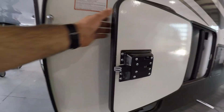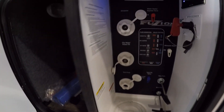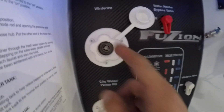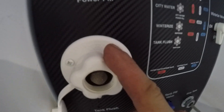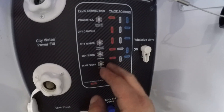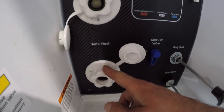Right on the driver's side here you're gonna have your hydraulic level. Right to the right of that you're gonna have your water inlet. You got an outdoor shower up top. You got, for winterizing, where you're gonna connect your water hose to. You can change the adjustments if you want to power fill it, or if you want to use city water just off the water hose. Black tank flush.